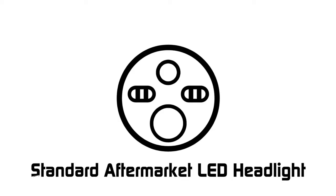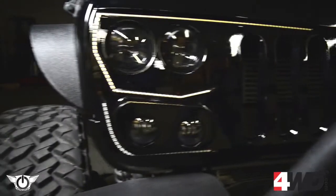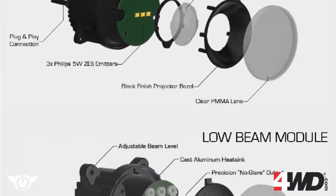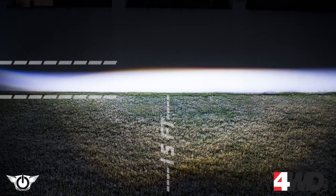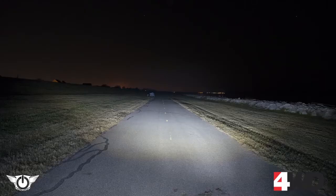We designed the Vector Grille specifically for this reason. By moving the driving beam, low beam, and high beam out of the same assembly, designing precision optics, and making each beam individually adjustable, we're able to prevent glare even on lifted Wranglers. Here's an example of a wall test from 15 feet away — you can see there's a very distinct cutoff line where the light pattern does not glare or bleed into the visibility of oncoming traffic, but the same light gives you ample visibility off road and on a dark road at night.